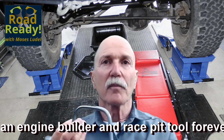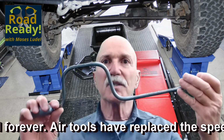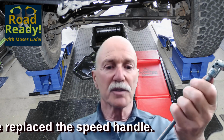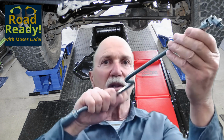I had a co-instructor at the San Diego Job Corps in the early 1980s who swore by the use of a speed wrench. And the technique that he used, which we all should use, was to leverage torque in this part of the handle and become used to the presets of 15 foot-pounds or 25 foot-pounds. Very easy to achieve with a speed wrench. Breaking sockets loose is not as difficult as you might imagine if you leverage the torque on this tool.